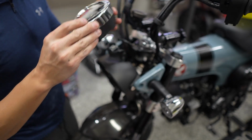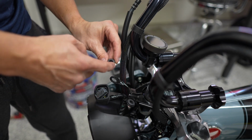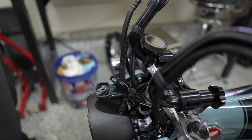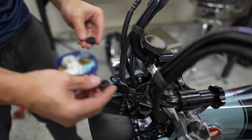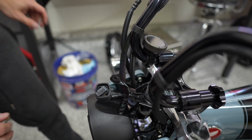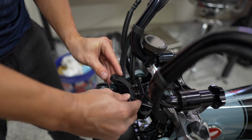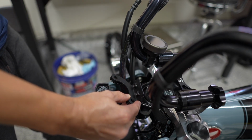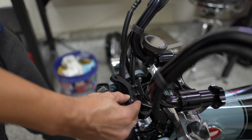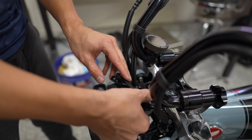Okay, old meter off. So this does have a very different bracket. Once you pull the stock meter off, there's these rubber grommets in the stock bracket that you remove. Keep them for some other project. The kit comes with these 2 washer collets. You pop them down in this hole. This bracket then goes on top here, and there are 2 M6 Allen bolts that thread through. And then the kit comes with good looking acorn nuts and washers for the other side.